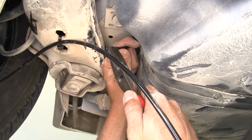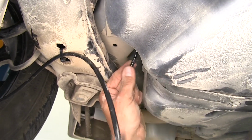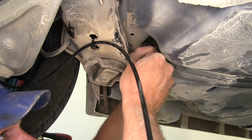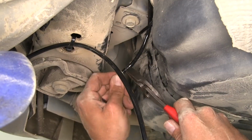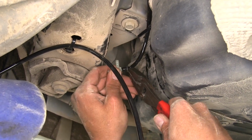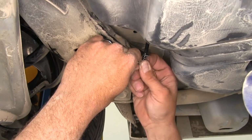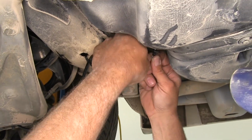And we'll take another one of our uni clips, slide up over our airline. We get our T slid up into position. Once that's in place, we'll bring our uni clamp down and over it there. Now we'll take the driver's side and we want to cut it to length, and we'll slide it on the other side of our T here.